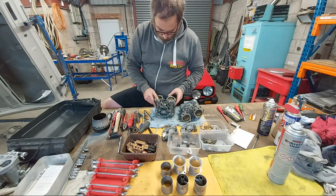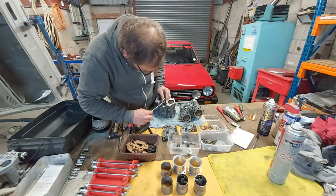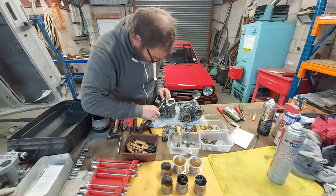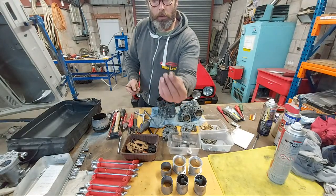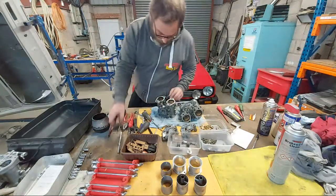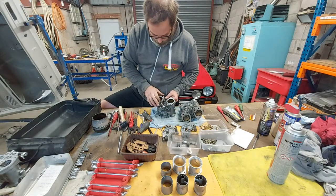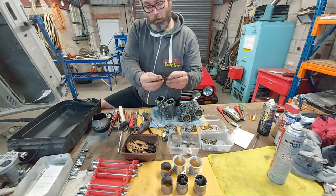So now we've got the pump rod. Let's slip the pump rod off. Alright. So undo the screw. It's got like a domed screw, slotted screw. Looks a bit like that. Yeah, that goes in with steel. And then get like a wooden hammer and just back it off a little bit. Pass the spindle and open the throttle, and then you'll be able to pull it off like that. Alright.